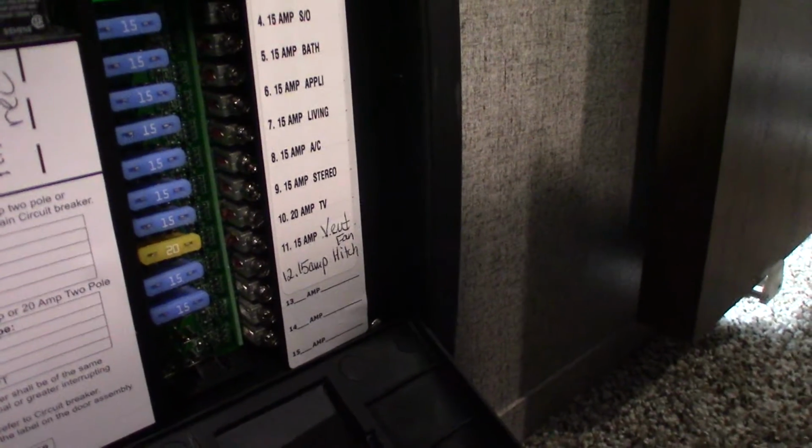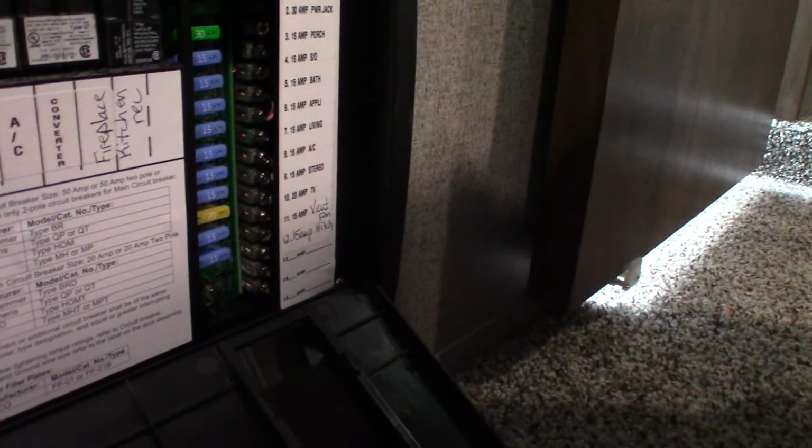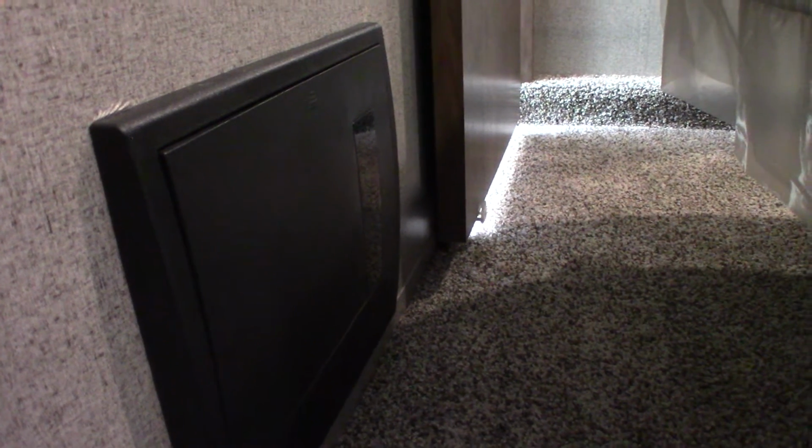If any of these fuses blow, they'll actually light up and you can see them through this tinted plastic here, right? But another main feature is as long as you're plugged in, this is a battery tender. So it'll sense how much energy your battery has or needs up front, and if it's low, it'll send 10 amps, for example. But if it's topped off, it'll just trickle a couple to keep it charged. So it's a smart battery tender. Okay. Alrighty.